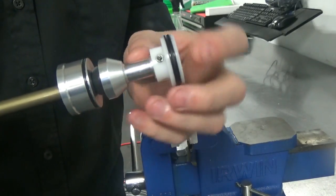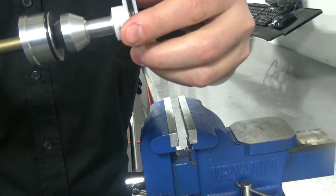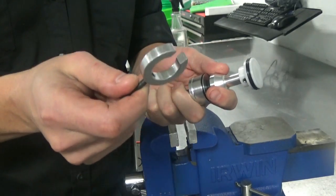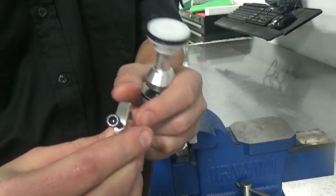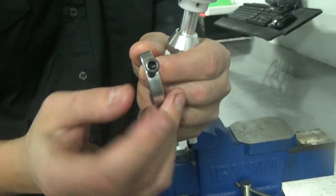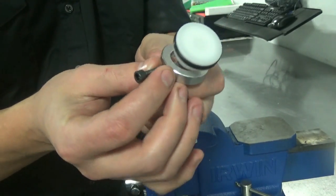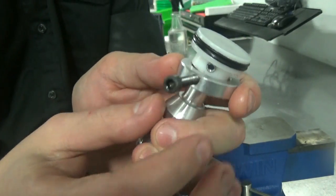What we're looking to do here is remove this roll pin. You'll notice it's sticking out slightly from one side. The tool to do it with is this roll pin tool. If you try this at home without the correct tool, please be aware you're doing it at your own risk. The roll pin tool is asymmetrical — this side is thinner than this side, and the bolt is not going through the center. We want to use the thinner side facing up towards the piston, just for clearance so we can get the bolt close enough into that hole.